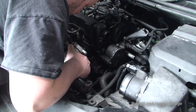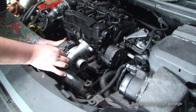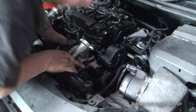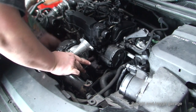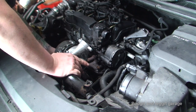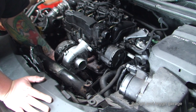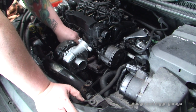And now we can just literally fit the turbo. If the feed pipe is around here you struggle to move it back inside to where the turbo should be. Now we have the turbo on. We have the return pipe on - not tight, nothing is tight yet. But these bolts now at the bottom are a million times easier to get to now than they were with the exhaust on. We had to take the exhaust off anyway to get that gauze out, and if you're not sure what I mean about the gauze, watch the first video.